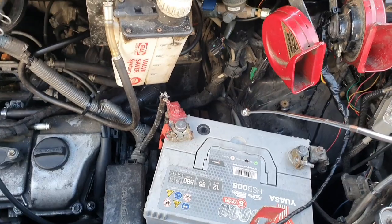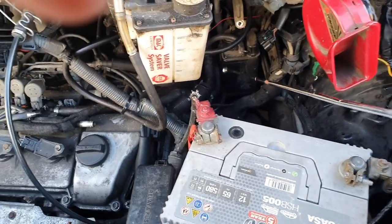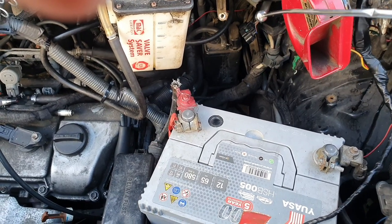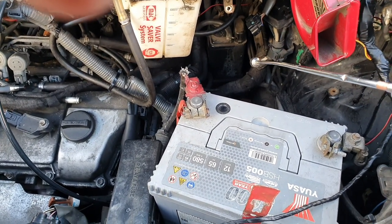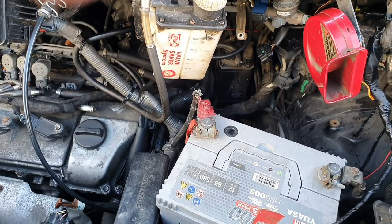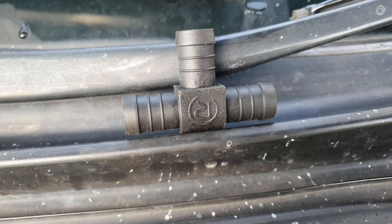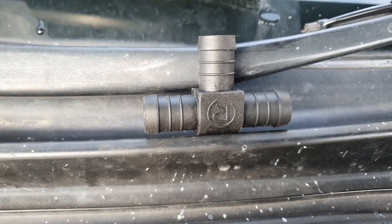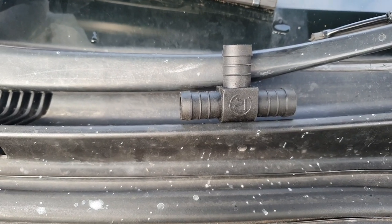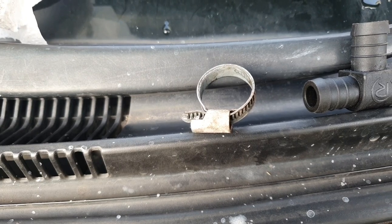Running my hands up the vertical pipes, I was trying to find coolant in the area where there's a hole splitter — a tri-splitter which supplies the LPG system with coolant to warm up the LPG gas before it's used. If you're finding coolant at the lowest spot, you then want to go higher up to see where it's actually coming from. In this case I thought the tri-splitter had gone wrong because that's where I could feel the wet coolant, but further examination revealed the coolant was actually dripping down from a hose higher up.